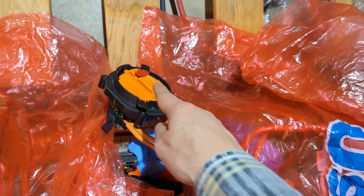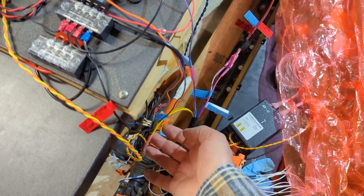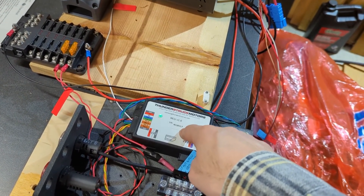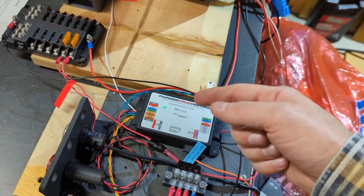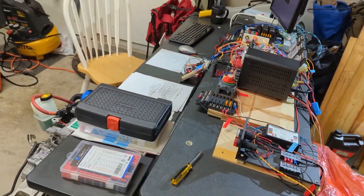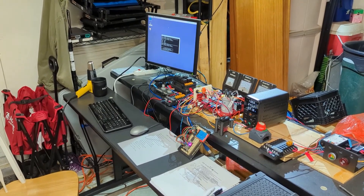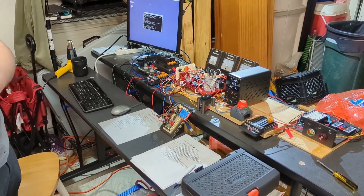The other things we need to do: we need to figure out how to get safety settings from the MCU tied in. We've found and wired up the interlock circuit wires in the Chevy Volt — it goes through the fuse disconnect and a small fuse panel, so if any of that's off those wires won't be connected. We want to use that as a loop signal to the MCU. We also need to figure out how to set an output on the MCU so that if it has any fault — over-voltage, under-voltage, missing a cell — we get an output that alerts us on the dash or keeps contactors from closing. Then we need VCU and MCU settings for regen, voltage, and battery balancing.